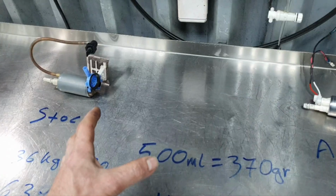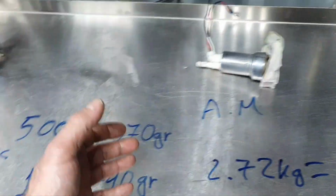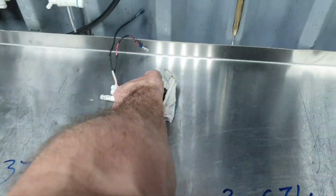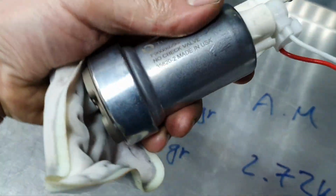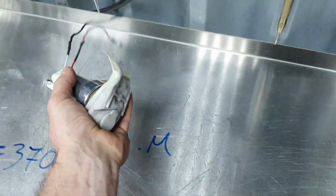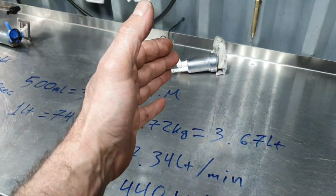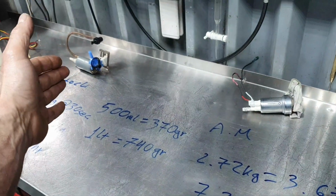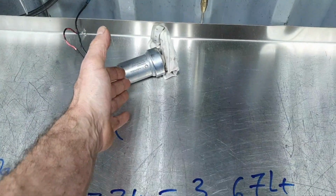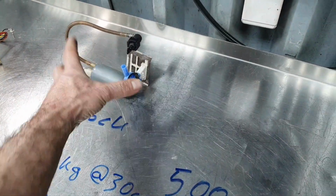You can see a difference, let us say, if you have a pump that's 100,000 kilometers old and you put in a nice and fresh new pump. The specific one is not right because it does have a check valve. And the irony, it's even written here, no check valve. And these guys put a pump like this inside. Don't ask me why. If you have a healthy pump, you're going to perform similar to this one. This one is with brushes. This is a brushless. This is a fully adjustable variable pump.